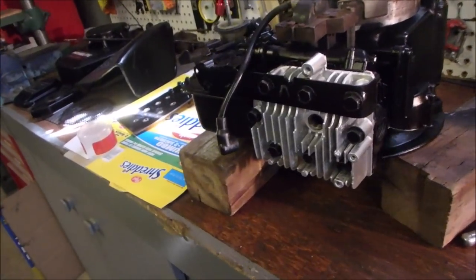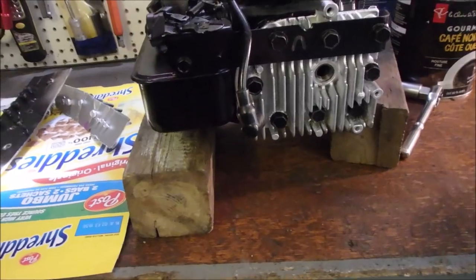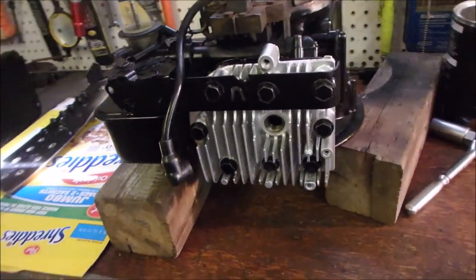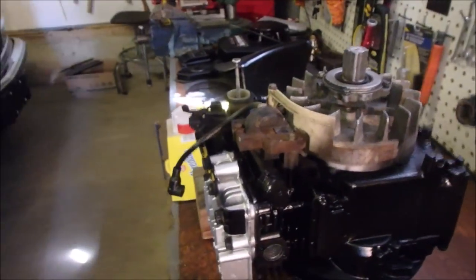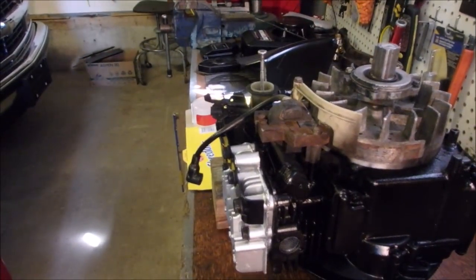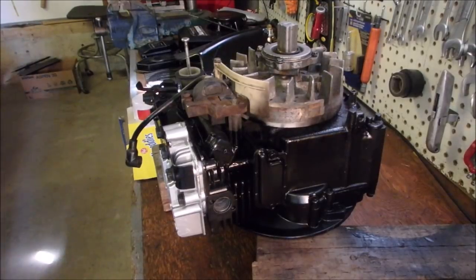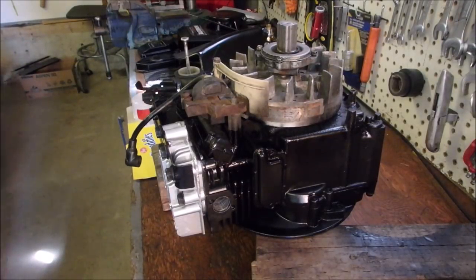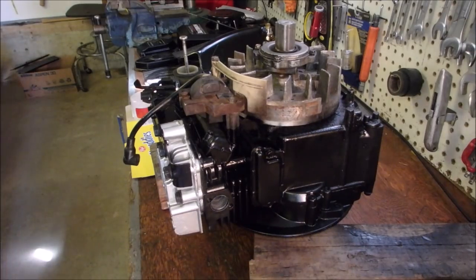Alright, I just slipped the head in with the black bolts. I just think it looks just too cool. They've just run in with the drill. For some reason that didn't record — dropped my watch. For some reason that just didn't record. So now I'm going to torque it down. We'll get that good plug back in there, and then the muffler. I'm just going to torque that down. I have to figure out how much 160 inch-pounds is in foot-pounds.